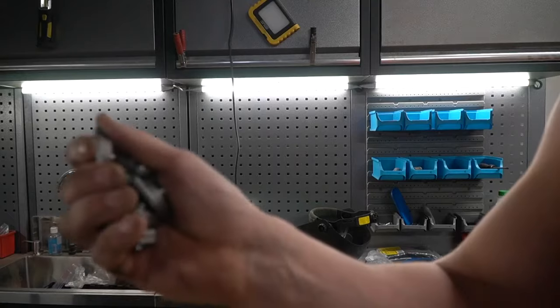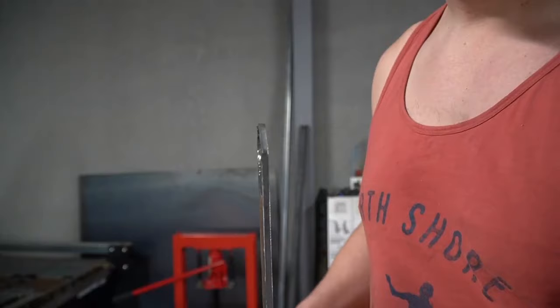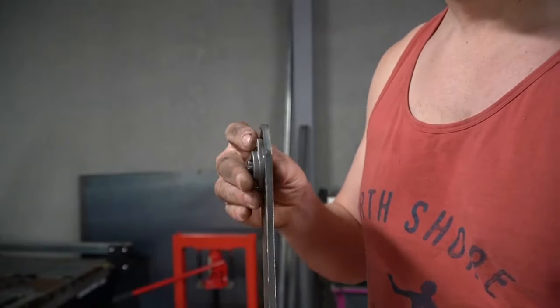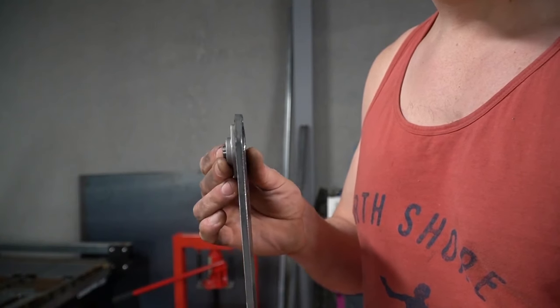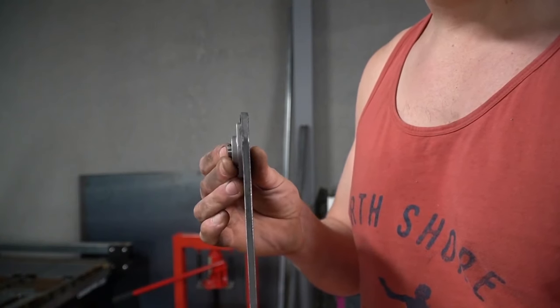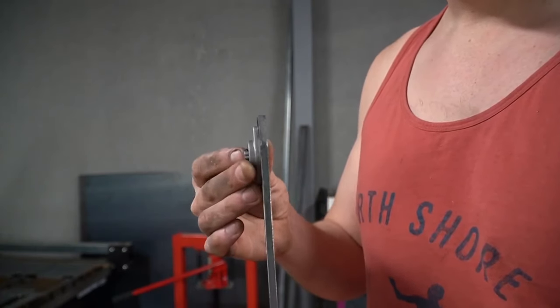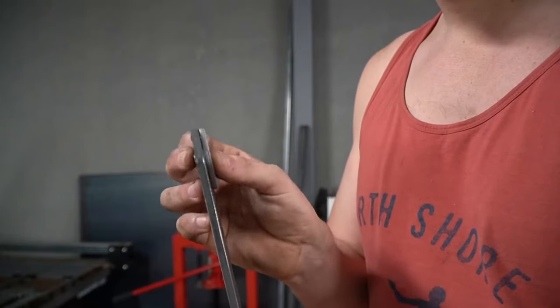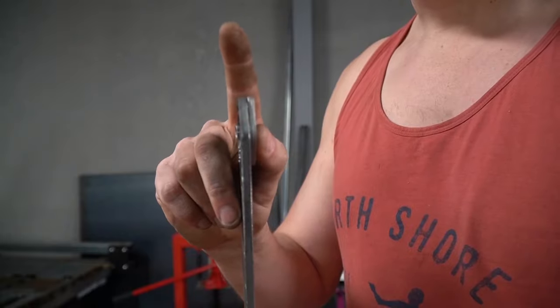And to solve this, I've bought some bits. Typically, you'd mount these bearings like this. But what this does is put an excessive bending moment on the bearing when it's not supported at the other side. So I've decided to use them wrong and mount the bearing inside the metal so that the force is transmitted with a minimal bending moment on the bolt. So I've got some welding and bolting to do. Have yet another montage.